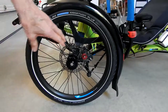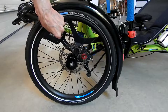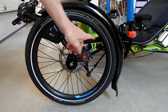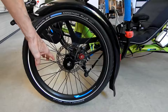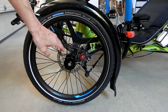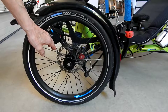Another thing I wanted to highlight that I neglected to mention before is the number of spokes. I'm used to 32 spokes on my ICE trikes, and I think there were 32 per wheel on my CatTrike 700. But all the wheels on this trike — the two 20-inch wheels in front and the 26-inch in the back — all have 36 spokes, which is impressive to me. The more spokes, the stronger the wheel. A little more weight, sure, but strength and durability are always of paramount importance to me.